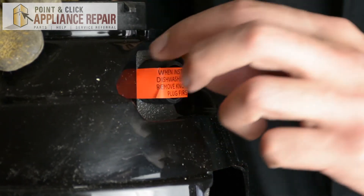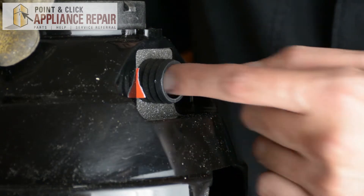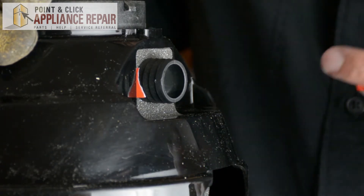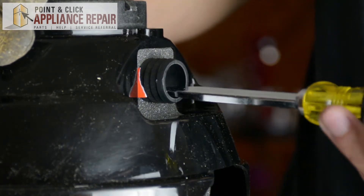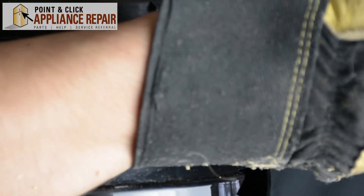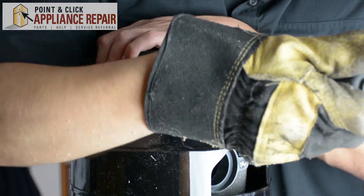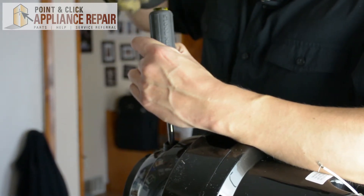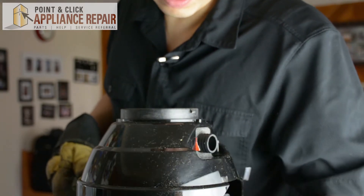Before we climb under the sink again, with our new disposal I'm going to get rid of this orange sticker here. What this is — it's for the dishwasher drainage. If you don't have a dishwasher drainage already hooked up, you don't need to worry about this part. However, for our example, we do have a dishwasher hooked up, so we need to take this sticker off. Then what we need to do is get a screwdriver or something else to poke in here and give it a couple of taps. There's a plastic plug that you're going to have to try and knock out. If it's really in there, get a hammer and tap on the end of that screwdriver. Here's the plastic plug we knocked out — it's in a few pieces. I'm just going to make sure I clean out the disposal and get the rest of those little chunks out.